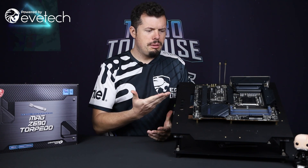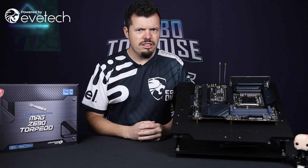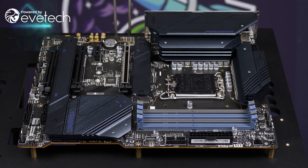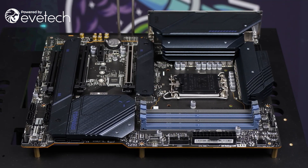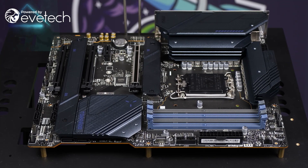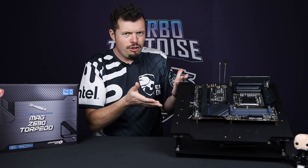I'm intending to put it on probably this exact motherboard for the upgraded test bench. The reason being is they create a lot more heat than they used to — I used to have to push the 9600KF to 4.8GHz to get any heat out of it for cooling tests. You don't really have that problem on 12th gen; they are very fast and they do get quite warm. I'll also be able to test DDR5, and even with the 12600K it'll probably outperform my main PC. We'll also be getting a new graphics card as RTX 30 series stabilizes. But this is the starting point — the first piece of the new test bench.